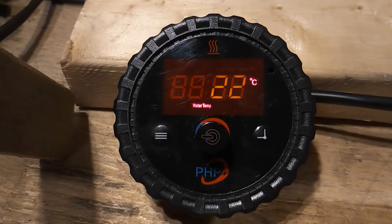Automatic climate mode allows you to control the maximum cabin temperature that the heater will maintain. This is a less common operating mode, and is only practical for cargo and cabin heating applications. This mode allows you to set the maximum cabin temperature between 14 and 40 degrees centigrade, as measured at the control switch. In this mode the heater will maintain a coolant temperature between 60 and 75 degrees centigrade. However, once the maximum cabin temperature is reached, the heater will go into standby mode.